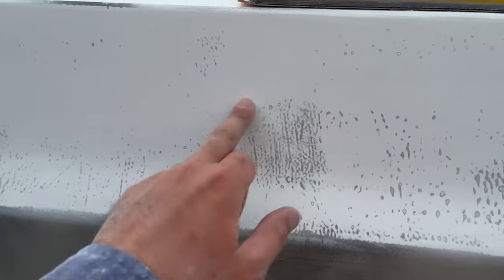You can see the black paint where the actual low spots are, so we keep sanding down the epoxy primer until we get a nice smooth finish, just as we did on the side of the boat here.